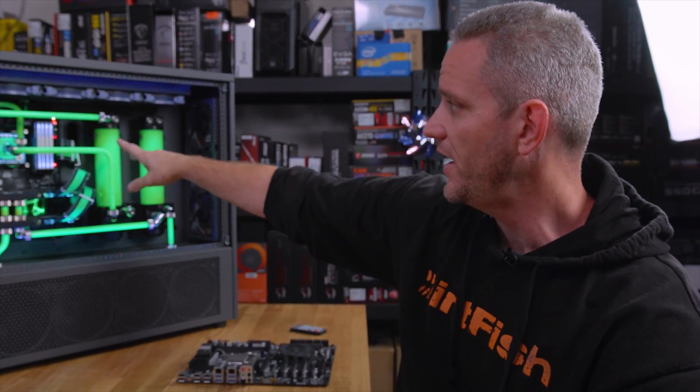So what we just dealt with right there is actually an undervolt situation where the CPU ran out of power, and it ran out of power so dramatically it didn't even have time to blue screen and kind of catch itself. It just immediately shuts off the system and restarts with this error code on the motherboard. So that's hopefully what we're going to eliminate — I'm not gonna change any of my settings, I'm just gonna de-lid it, put it back in there, and compare the results.